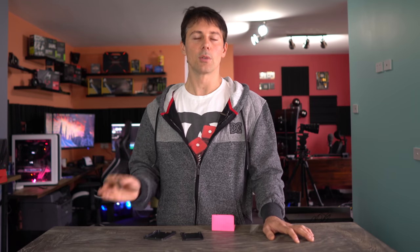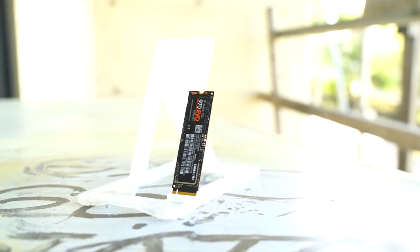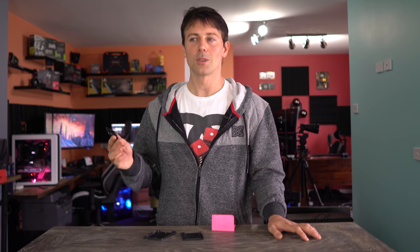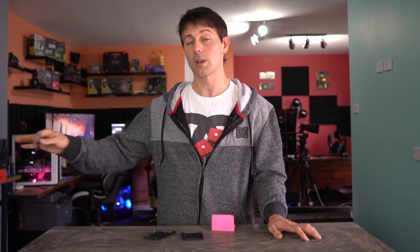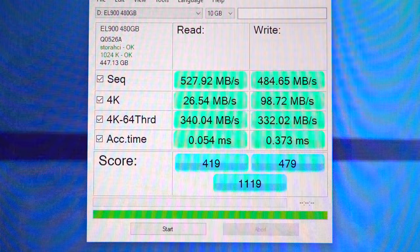The reason it doesn't throttle — as seen in the Samsung EVO 970 NVMe review — is that even when Samsung's TLC NAND flash throttles, its maximum speeds are much higher than SATA 3's 500 megabytes per second ceiling. So with Samsung's 3D NAND flash, even the cheaper TLC doesn't throttle because the threshold is never reached under SATA 3 constraints.